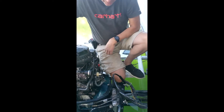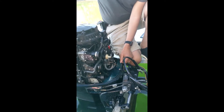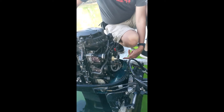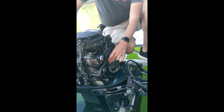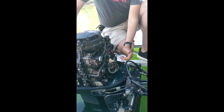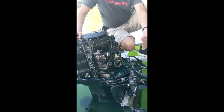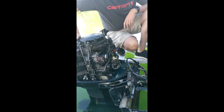This is our pre-mixed motor, so we put in pre-mixed fuel pumps. There's no oil injection — that's the way the customer wanted it and that's the way we wanted it. This is a fuel strainer. This is where the fuel comes in after it loops through here. The strainer is not really a filter — the manufacturer will call it a filter, but it's really a strainer. The only purpose I like it for is: I can tell you if your fuel line is falling apart, because I will take this strainer off — it just threads out — and if it's got black particulate in it, your fuel lines are falling apart.